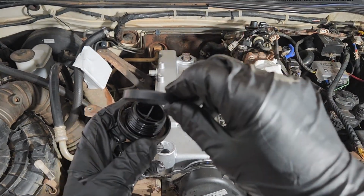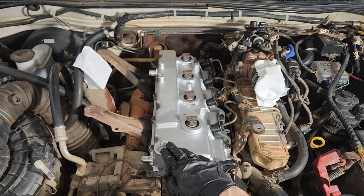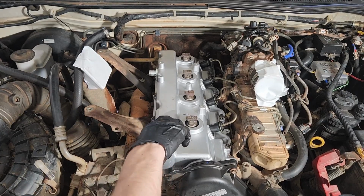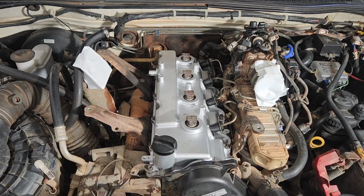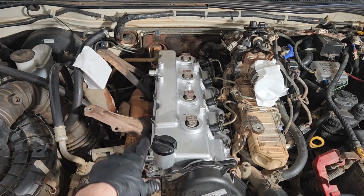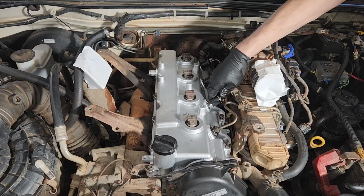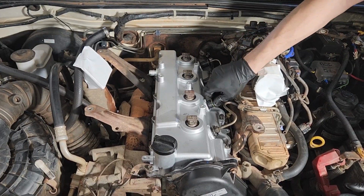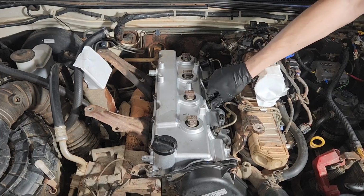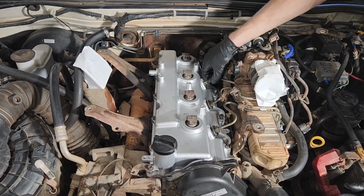We also get a new gasket for our filler, so we're going to put that on. A little bit of oil, and we'll stick it on here. Now we'll torque these up after we've fitted these. We'll push all these in and we'll tighten up all our injector lines. Then we'll torque down the rocker cover. We just want to line them up with the end of the injector, push our seal in, and then we can wind the nut down. Make sure that seals all the way home. We can push it in a little bit later as well if we need to.